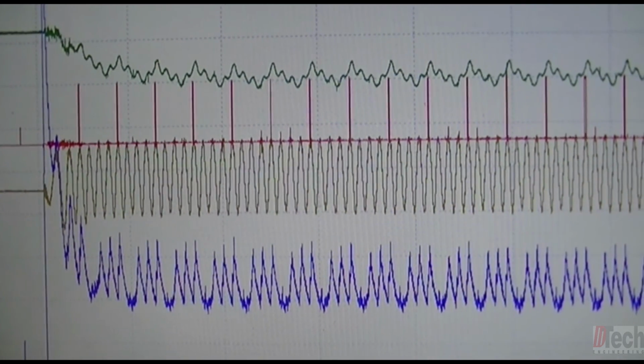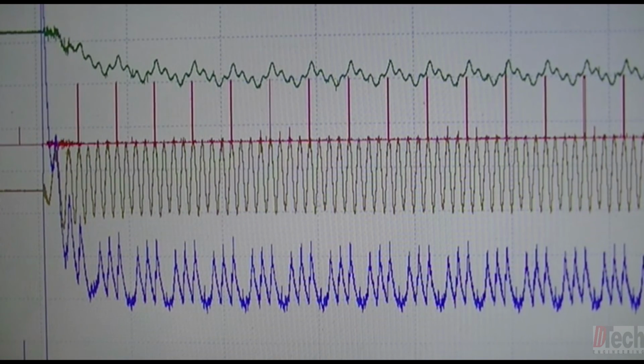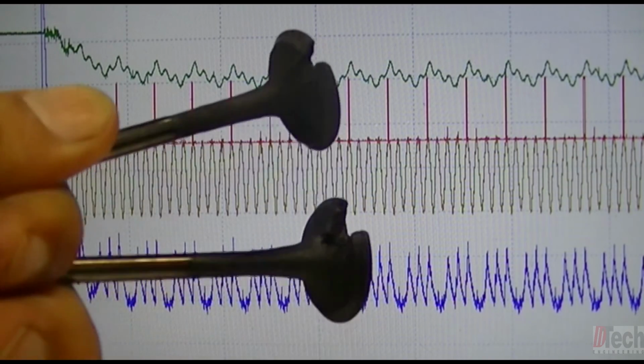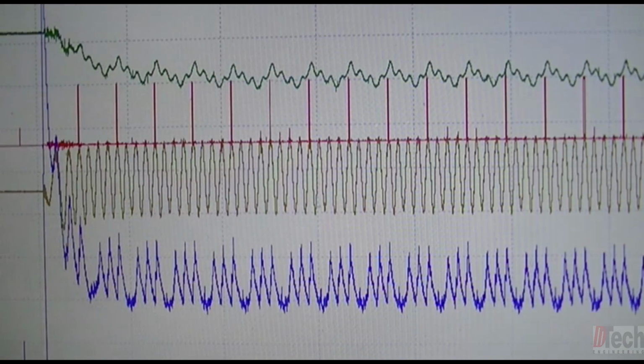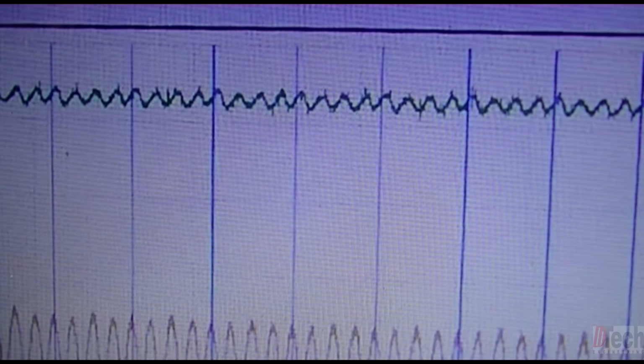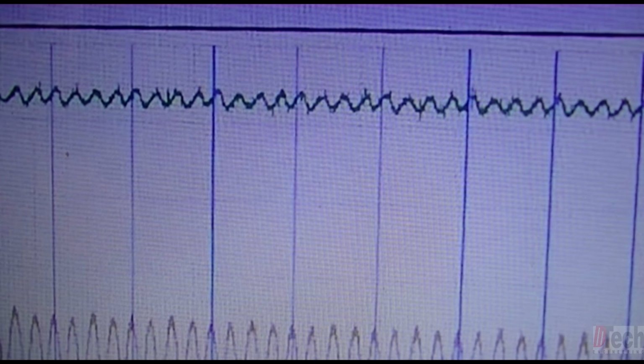Again, these two vehicles could very easily have been quickly diagnosed. Relative compression gives you the answer right away when you need to make a call for what to sell a customer, basically, or what situation you guys are going to be in. But I, for myself, just needed to find out and figure out how two of the same failed things cause two distinctively different patterns on the intake trace. So that's basically what I came up with, and that's the only thing that was different.